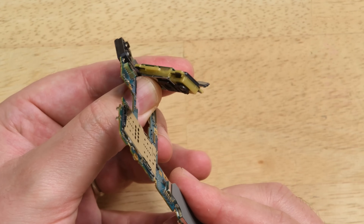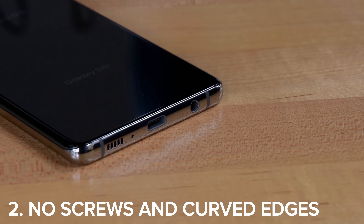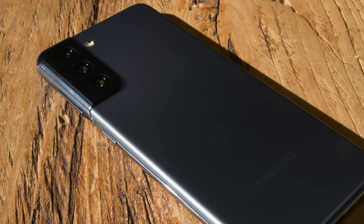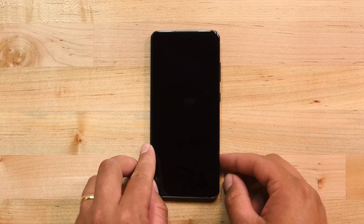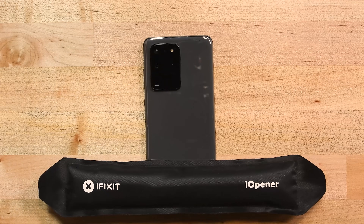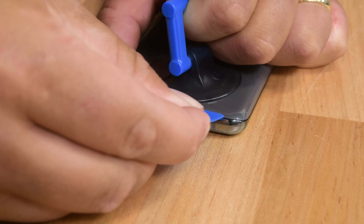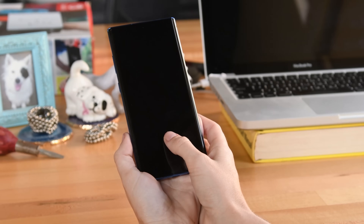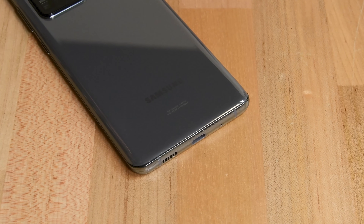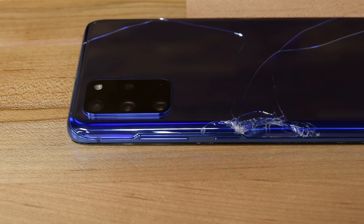But there are some notable exceptions. The second thing you'll need to know is there are no screws holding your phone together from the outside, because most Samsung phones are glued shut. The point of entry is the rear panel, which is not only glued down but also made of delicate curved glass. To remove it, you need to heat the rear panel's glue to soften it, then gently pry it off. Those curved edges make the rear panel more difficult to remove and more likely to crack, especially if you rush through the heating and prying process.